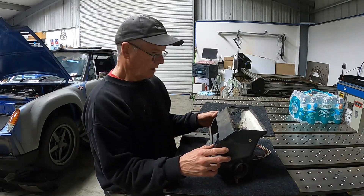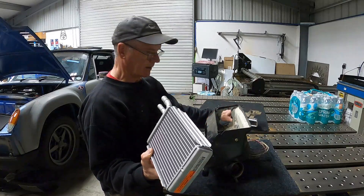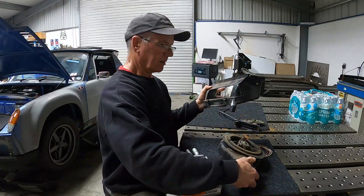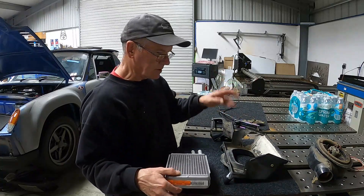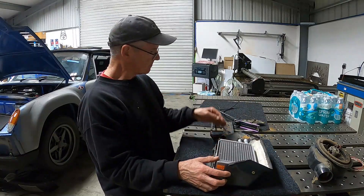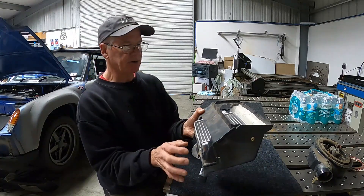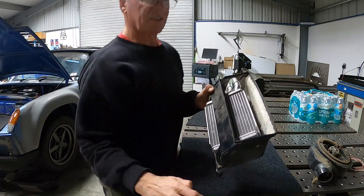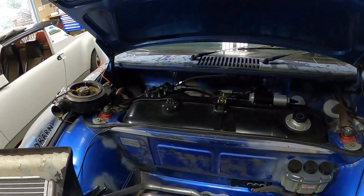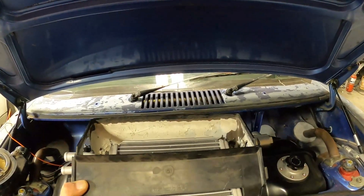The typical thing to do is what you're seeing here. This is a heater core out of — I think it's like a '94 Mustang. And I've disassembled the fresh air box. I'm not the person who invented this by any stretch — this has been done — but you can get a heater core in here, and then this will sit over the top of it. Obviously it needs to be modified to cover everything, and there's also a rain hat that goes in here. Where this lives, that opening fits up underneath that grille opening at the base of the windshield — a high pressure area.